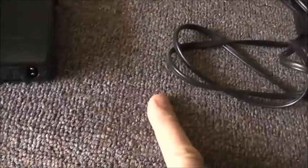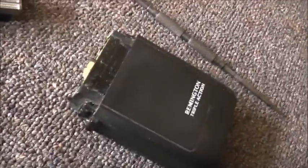Underneath that little plate you've basically got a coil with a tap in the middle. On the end of the tap you have the 240 volt connection, and in the center of that winding is the 110 volt connection — that's where you switch it to 110 volts for use in America, its native country. I personally find these coil-principle shavers that run off the mains frequency are actually quite more reliable. I could plug it into my VFD and run it off different frequencies, but it probably won't vibrate as effectively because this is designed to run best on 50 hertz to get the most movement.